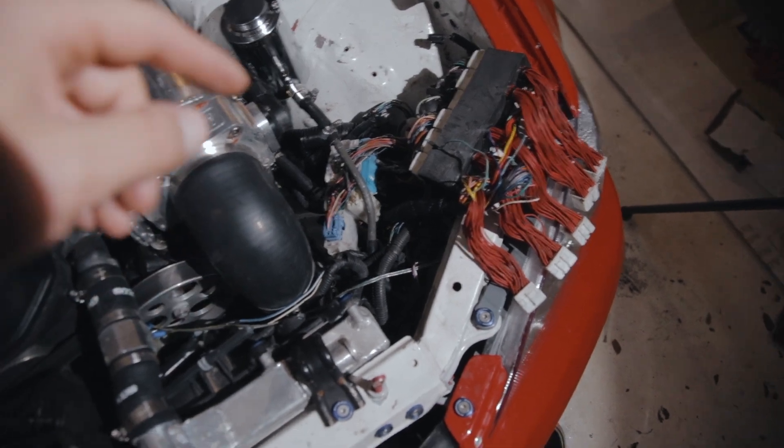I was very gentle with it, and then the next day I got it tuned, which was very important because you want to make sure the air-fuel ratio is correct. Two downsides to doing this: I don't have cruise control anymore, and I don't have traction control that works anymore. But I don't need those for what the car is used for. You do have to relocate the ECU box that's next to the intake manifold, and you do have to relocate a few of the other lines. I was going for a budget build, so I wouldn't cut corners and go cheaper, because you're going to wind up spending more to fix issues and potentially damage your engine.